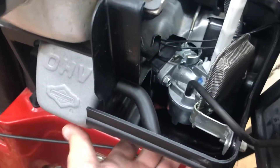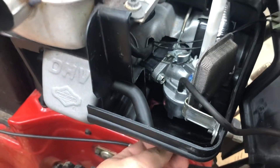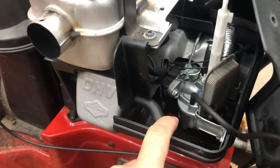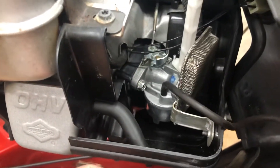If you want to clean the jets, there's basically just two jets in the middle. You just take the bolt for the bowl off — that's one of the jets — and then inside there you need a flat blade to get the other jet off. Once you get those, soak them in some carb cleaner overnight and your machine will run a lot better.